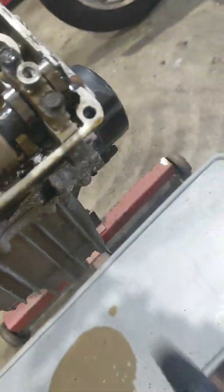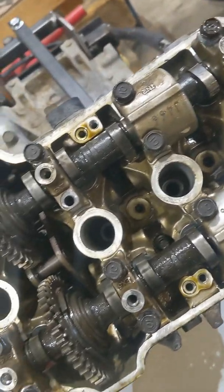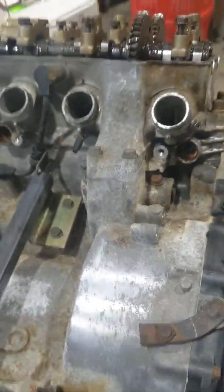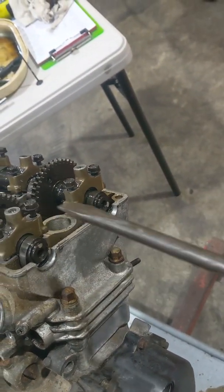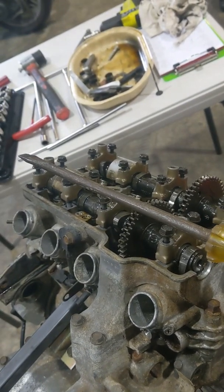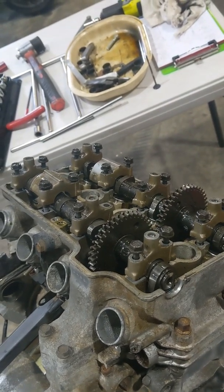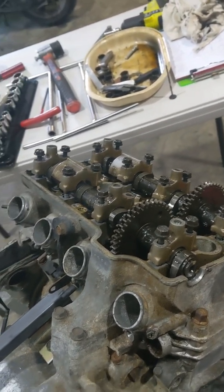You'll notice these are marked — exhaust 1, 2, 3, 4 — and there's also a curve on the front for the spark plug hole. This number here, J466, corresponds to the number stamped in the head. In the machining process, the caps are screwed down to the head and they run a lineal bore through all the caps and journals. That's why if you break or lose one of these caps, the chances of making one fit from another head are slim to none. Don't lose your caps.